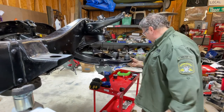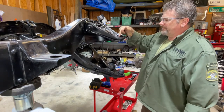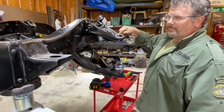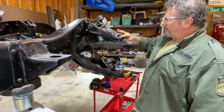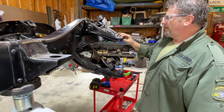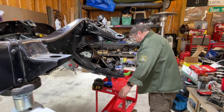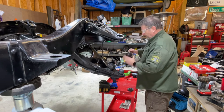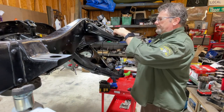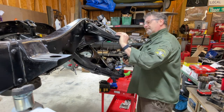Get your grease boot on and you're ready for the upper. If this has never been replaced before, this will be pop riveted in. You'll have to grind the tops off, smack it through with a punch and a hammer. If it's been replaced, you're just going to have four holes here for your bolts to go in. This will only go in one way — put that in there like that, this goes up.